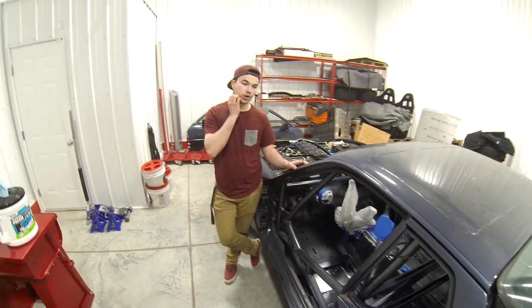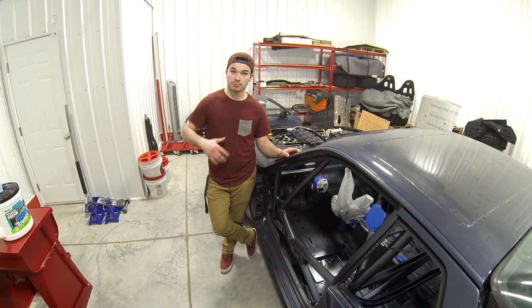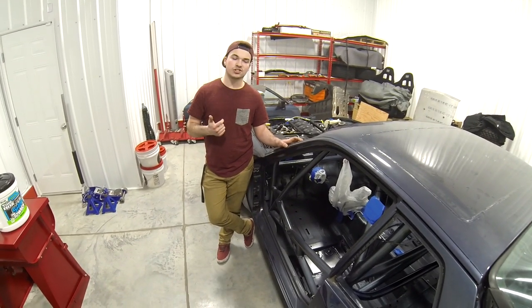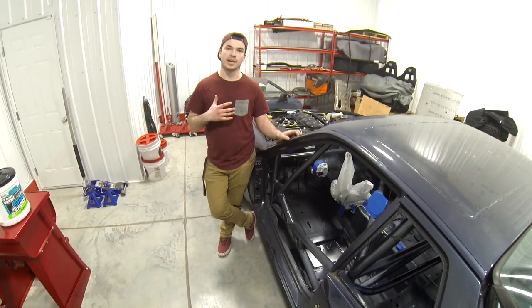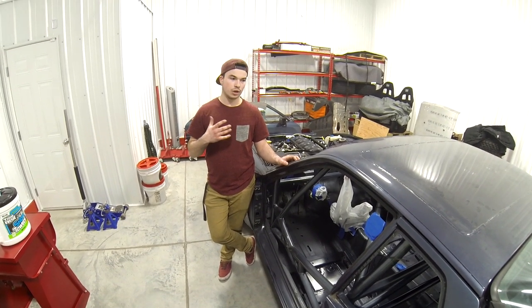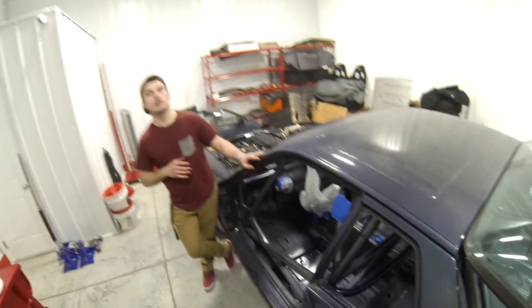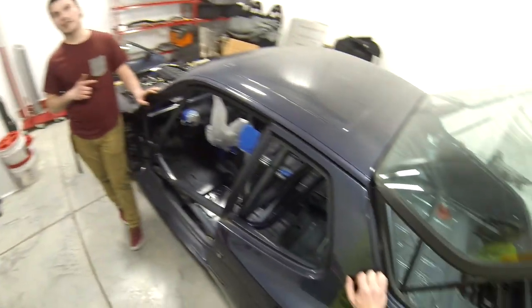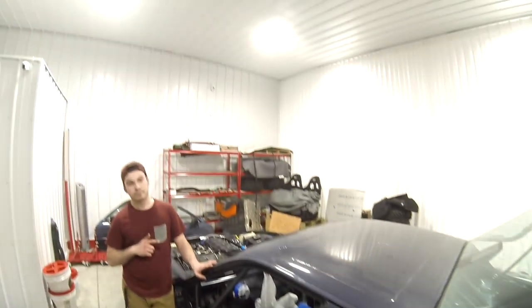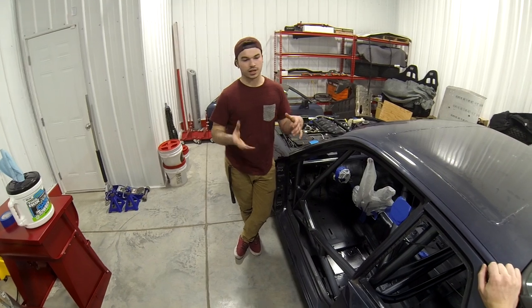Okay. Whenever you're painting, if you paint in a really cold environment, all of your cure times go up exponentially. So if you're at 50 degrees, be very mindful of that because it's going to be really easy to run the paint. Also, just because your shop's 70 degrees doesn't mean your paint is 70 degrees. Most of the time, your metal temp is actually 10 degrees lower. Fun fact. Really? Wow. It depends on whether you've heated it up all day or if you let it sit outside for a day.